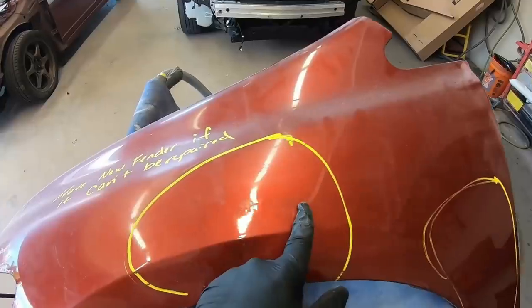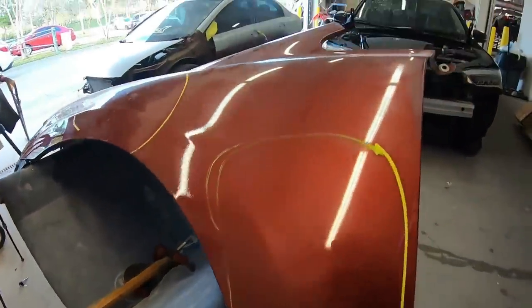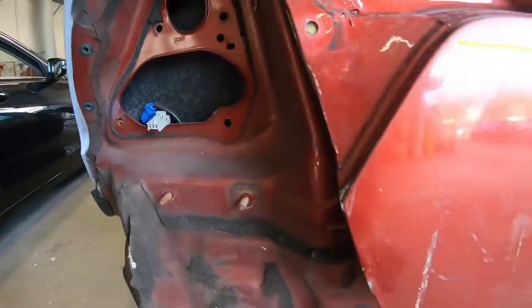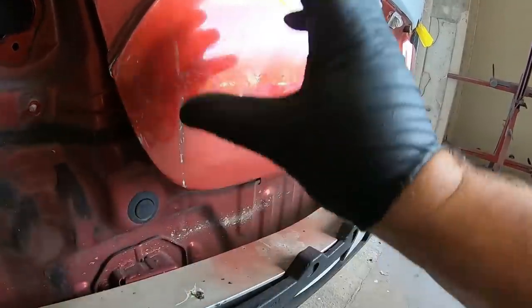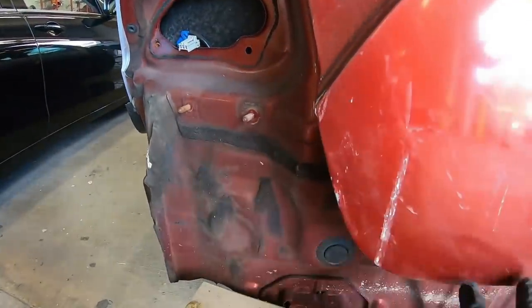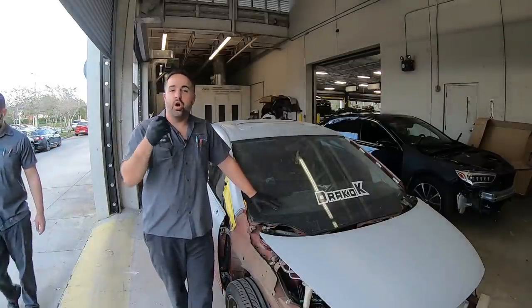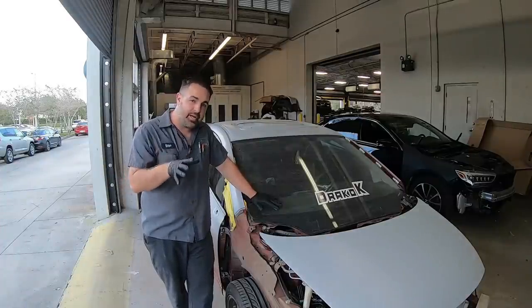Looking at the fender we can see it's got some weird denty little areas and some dents along this area — nothing we can't handle with a little bit of filler, so we're going to show you how to address that. Coming over to the back of the trunk, this was a very bad dent before, but we got our PDR specialist to get it about 95%, and we have a little bit of waviness in this area. There are also some small dents around the car, but we really want to focus on our fillers, what fillers to use, and what blocks and sandpaper. So we're going to get right into it now.